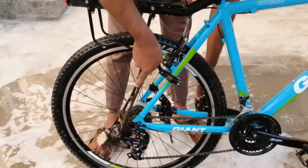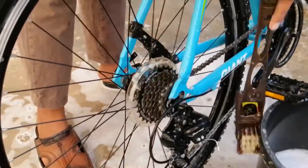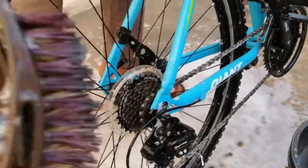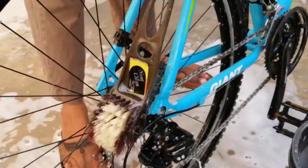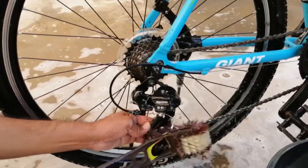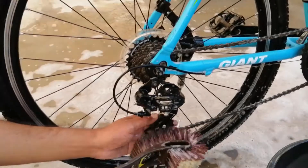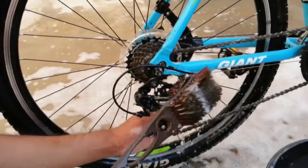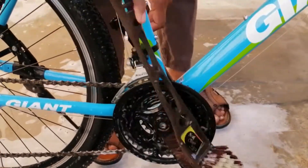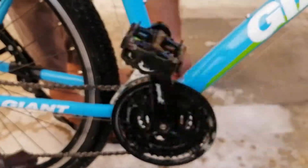Now turn to cleaning with a brush. There are a lot of places inside the bicycle that can't be touched with a cloth — in some places it is dangerous and there is a risk of injury. Brushing is very good in such places. Dip the brush in the soapy water and repeatedly soak and clean these areas — it will save your time and improve cleanliness. The rear and front gear systems can be cleaned very easily with a brush. Since lubrication is applied in these places, mud is well deposited there, so use the brush for some more time so that everything comes off.